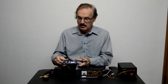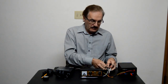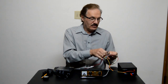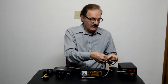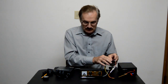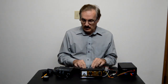Secondly, make sure you got the microphone plugged in. Take a look at the front of the radio, keep that plugged in, and then we're gonna plug this into the power supply. Over here we have the red wire matching the red wire — open that clip up and plug that in. Then we're gonna put the negative one on the negative side. I like to keep a little bit of an insulator around; you can notice I use a little piece of rubber there from the speaker, and that helps keep the wires apart. That's important, because if you don't keep the wires apart you're gonna blow a fuse — you might blow a fuse here or you might blow a fuse here, so hopefully you don't blow a fuse.